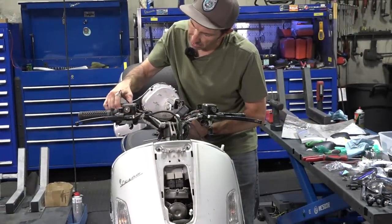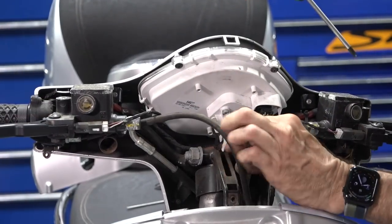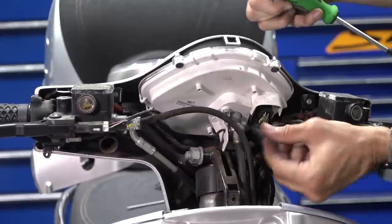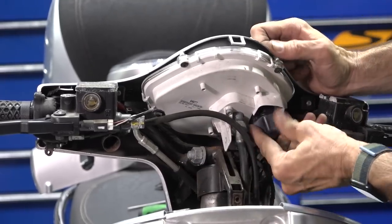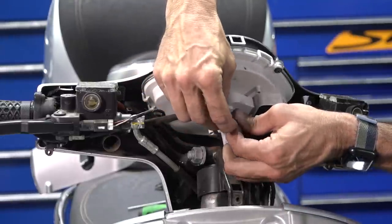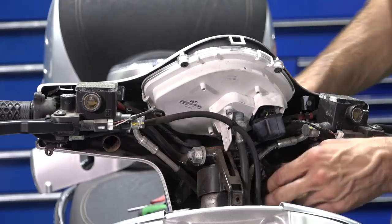Let's get the rear handlebar cover back on — just all the connectors, and if you're unfamiliar with it I would tag them all, but they're pretty straightforward. A couple of things not to forget: the speedometer cable, all freshly lubricated. Spin the little lock nut back in place. There's a little zip tie that holds the boot; they never really stay in place, they've always been temperamental. Note this is such an old model it only has a single throttle cable — all the later stuff has dual throttle cables as a safety measure.